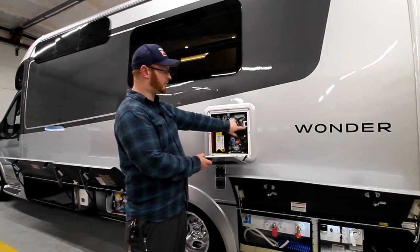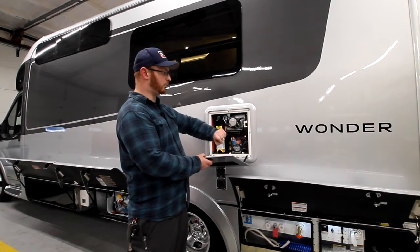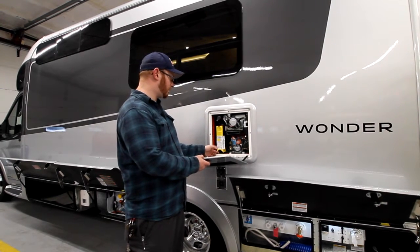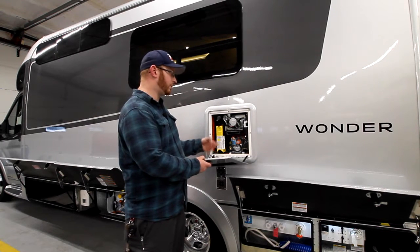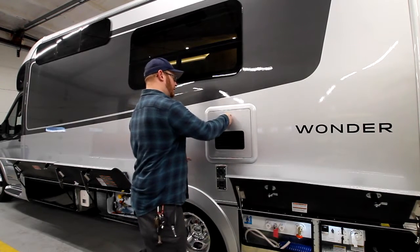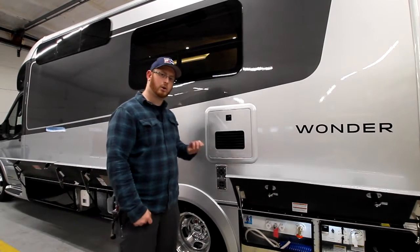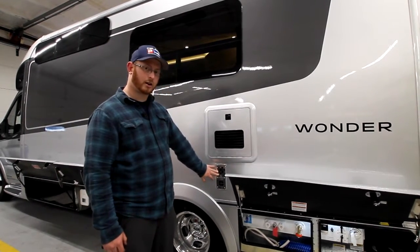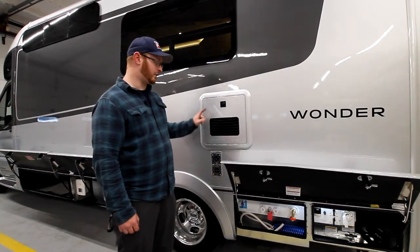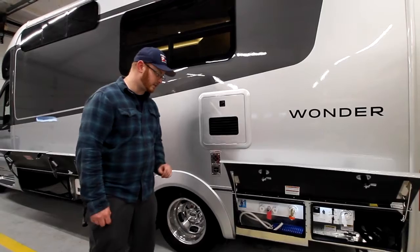We have our power — on up or on down, it doesn't matter, on is on. Once you have 12 volts, you'll see a little green light illuminate. Right now I don't have any water in this as it's winterized. Once you put the filter in and fill it with water, that's going to stay green. I'm going to turn it off only because it will turn red and give me a fault showing that there's no water flow going through the unit. Below that we have our furnace — make sure that you put this back up before turning on your furnace as you can melt this door from the furnace exhaust.